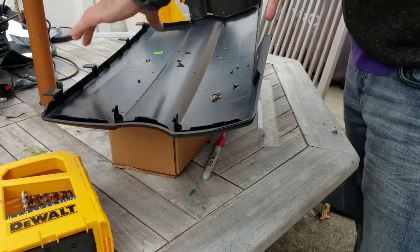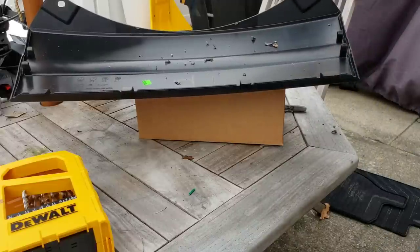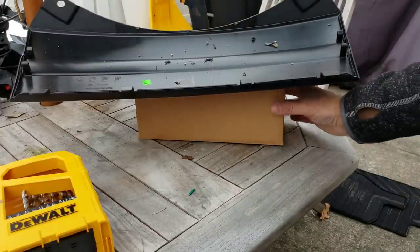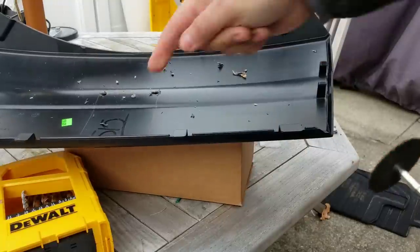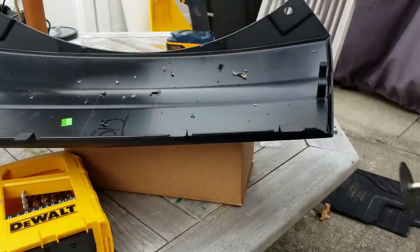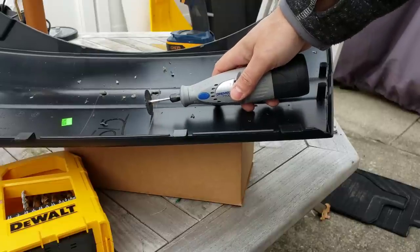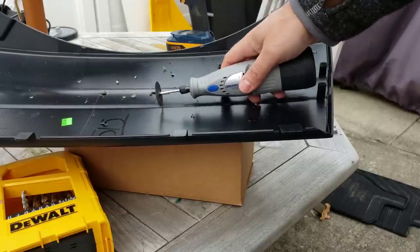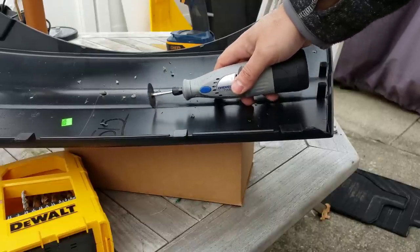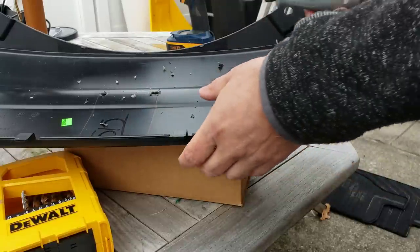And the key thing to do is to determine where you're cutting along the line. A lot of people get kind of crooked lines because they're trying to cut down the middle and they're going back and forth. The line has a thickness to it. So in this case, I'm cutting outside of the line, not down the middle and not to the right side. And I'm going to consistently stay on the outside of this line so that my line ends up being straight.